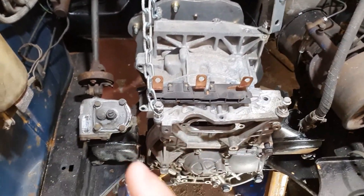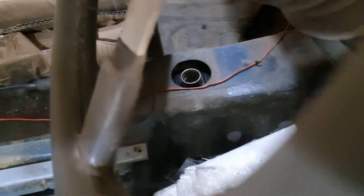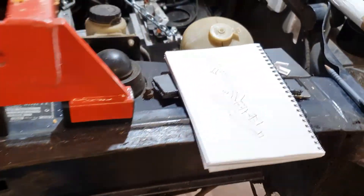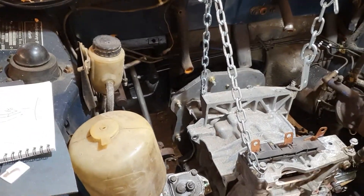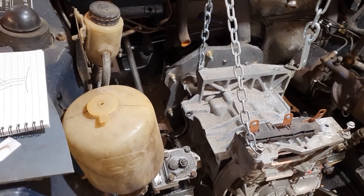As you can see, it's just sitting there in the correct position. We have the motor and gearbox sitting in situ - I haven't linked anything up because I know it's in the correct position. You can see where the gear shifter is - that's exactly in the right place. But before I do any sort of setting up of engine mounts, I'm going to connect up the prop shaft going through to the rear diff to make sure it's exactly in the right position before I do the final welding.